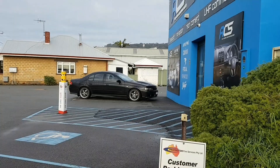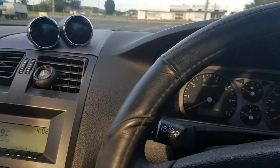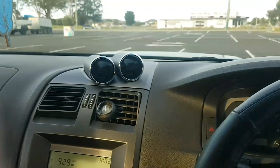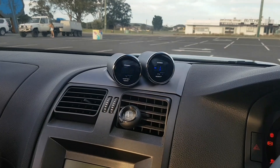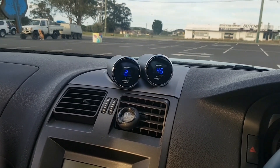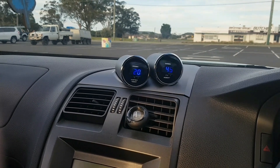I've got the car back - gauges are in, the shift kit's in. You can see I've got a little switch down there for turning it off. But in typical fashion, eBay has finally bitten me in the ass because these gauges are sweet but it's reading 45 pounds all the time, so either the gauge or the boost sensor is screwed. I'm going to have to get a new gauge unfortunately.